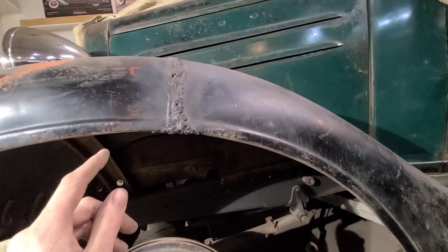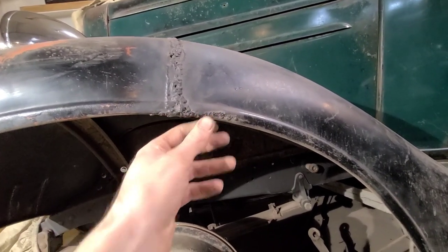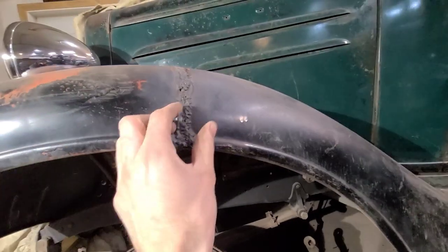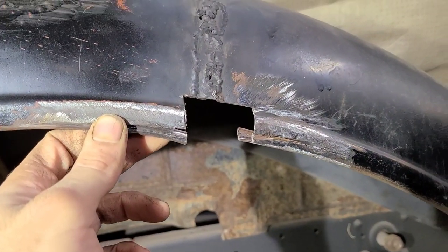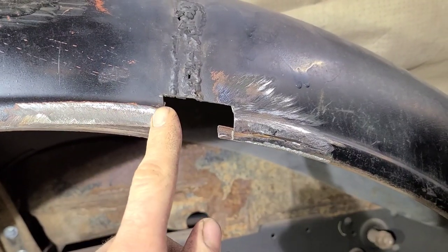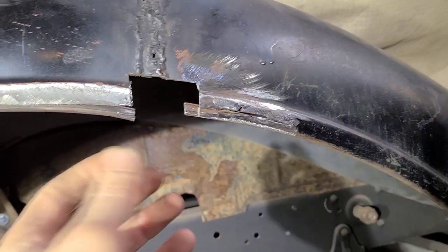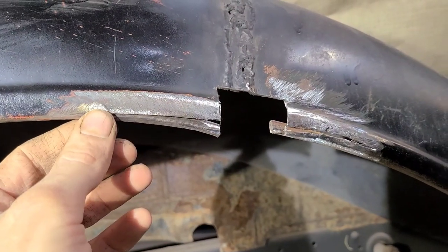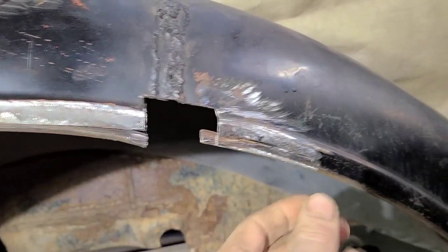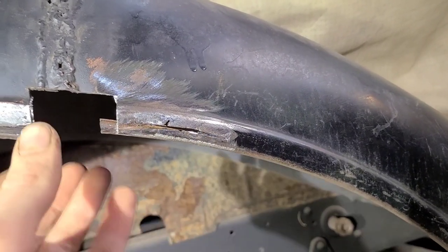What I'm going to do first is start by cleaning up all this mess and see what we have left to work with. I'd like to save as much of this as I can. This section is going to have to be replaced. As with our dent repair theory, we're going to start on our edges and body lines and then work our way in. Our first task is to reconstruct this - I'll start by welding this and then bridge this in.